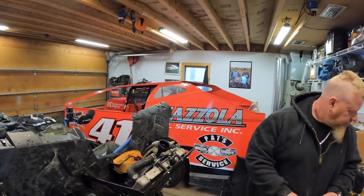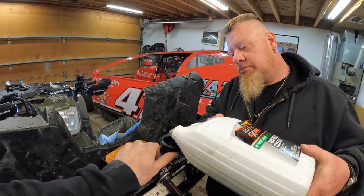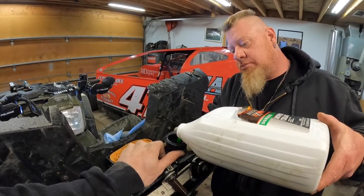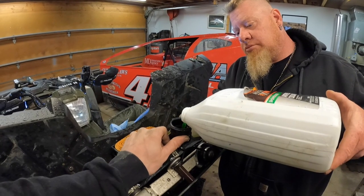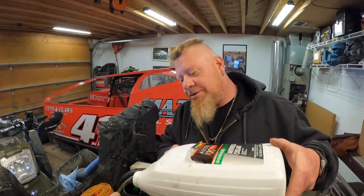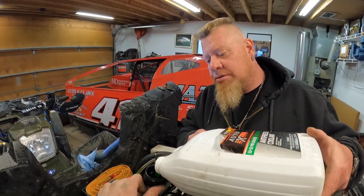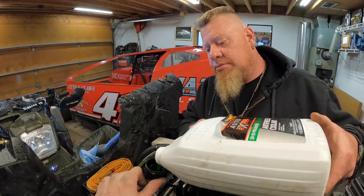Filling time. There are a couple of ways to do this. Sometimes you just dump it right into the fill — but it depends on the system. When you have bigger systems, sometimes I'll pop one of the radiator top hoses off, fill it most of the way, and then fill it from the cap. Otherwise you've got to go delicately. We actually have a burping bucket thingamajig from Amazon — you mount it on the radiator cap and run it up to temperature.